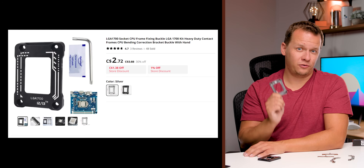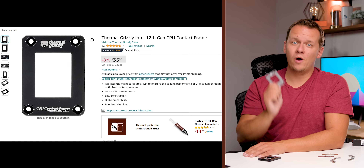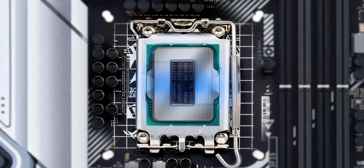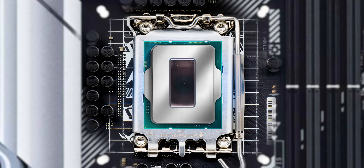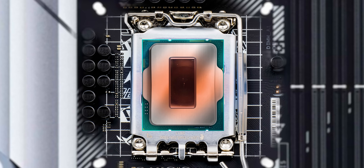The next thing to tackle are contact frames for Intel 12th, 13th, and upcoming 14th generation CPUs. While the AM4 offset brackets are dirt cheap, these vary in price wildly — from about four or five dollars off AliExpress from an off-brand manufacturer to way over twenty dollars. The stock ILM, or integrated loading mechanism, puts an incredible amount of pressure on the processor's two retention tabs. Over time, coupled with high heat, this can slightly warp or bend the CPU so its integrated heat spreader becomes slightly convex in the middle, leading to less contact with the cooler's base plate and higher temperatures.